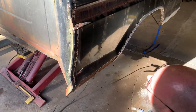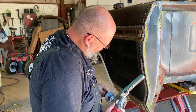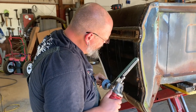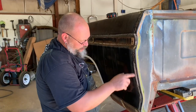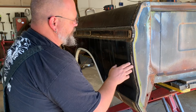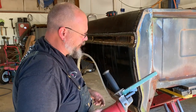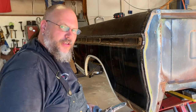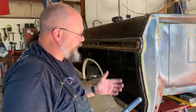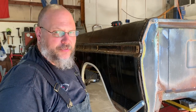We'll come back when we've got this all stitched up. The main thing to remember is just stay on top of your weld, and as your weld comes down you'll see it touch — just do a quick dress and clean up the edges where the weld flows in nicely. In our shop we use a belt sander for a lot of this type of work. The main thing is use a tool that you're proficient with. Some guys use grinding rocks and are very proficient with them. I like a flap wheel or a belt sander — a lot of times I'll take a flap wheel to knock the tops off and then get back with a belt sander to finish.